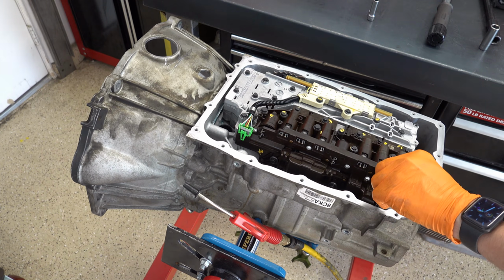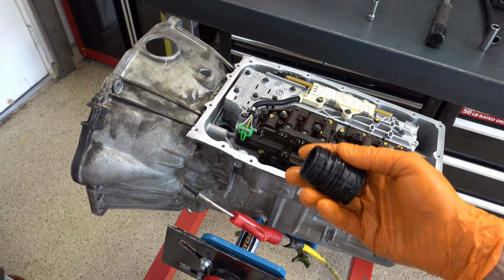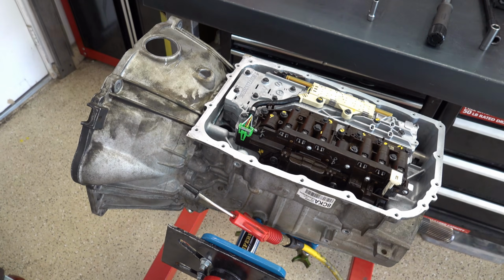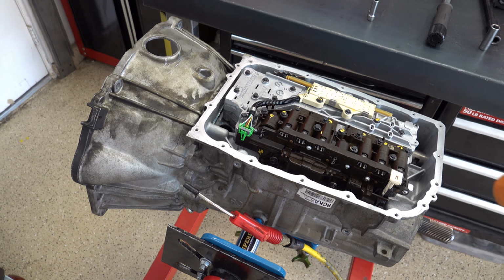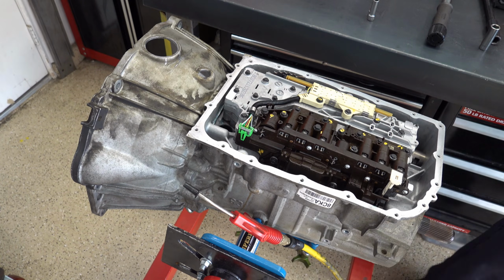Okay, make sure this lever is all the way up so that you can install your pass-through case connector. So you'll have a lip seal here and 2 O-rings here. And they, of course, come in the kit. And then you want to make sure you line up this little tab here, the engagement tab that you see, with the case connector on the TECM.